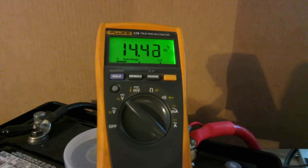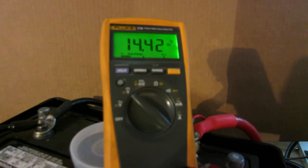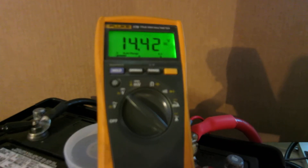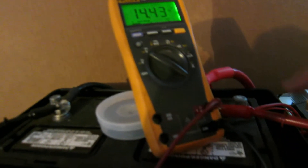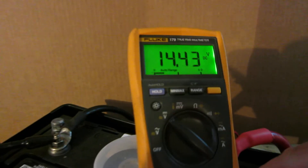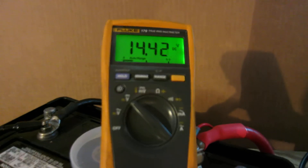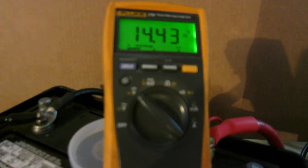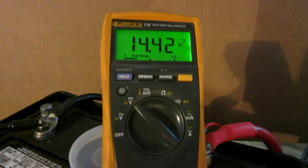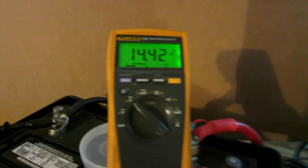The first parameter we need is the battery at absorption voltage. For most batteries we're looking at 14.4 volts or more. For gel batteries you'll be looking at 14.1. We want to make sure our voltage source is tapping into the positive and negative terminals and that we have an accurate voltage reading — best done by bringing your voltage meter or battery monitor directly to the battery terminals, which is done here. So 14.4 volts at the battery terminals: check.